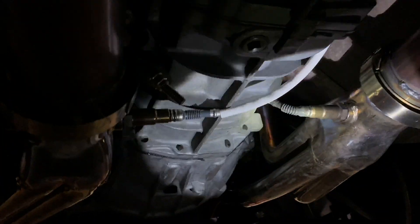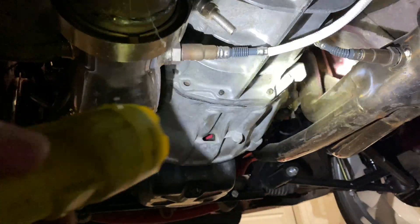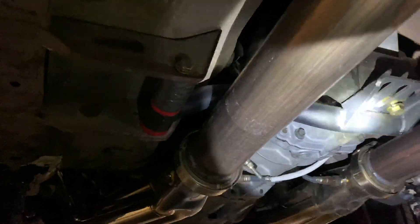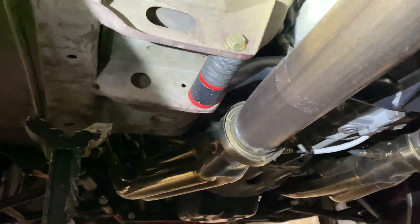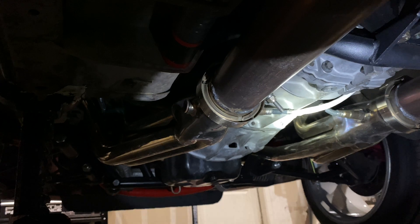What that means is you will have to remove the whole motor to get the transmission out. Now you see how close these headers are — I mean, I think if we were to remove this one we might be able to get it out. But are you willing to spend all the time trying to get it out, or just say forget it and drop the motor and tranny all together? The exhaust will have to come off, driveshaft, shifter — all that. Then the question is, how are you going to get the transmission out when the headers are hugging the motor and drivetrain so tight?